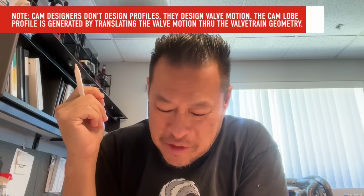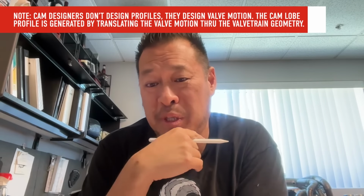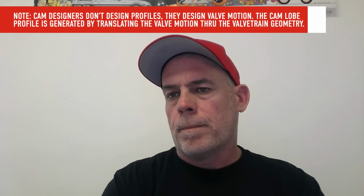I don't see any point of doing it on the dyno. If you want to see how unstable it is, I'd throw it on the Spintron and spin it on there. You'll see it start launching the valves way sooner. Yeah. All right, so